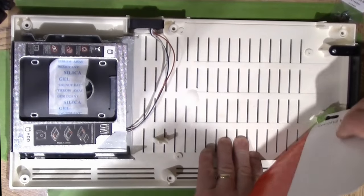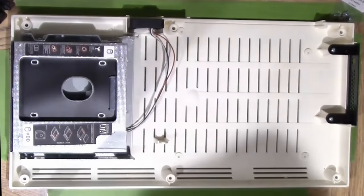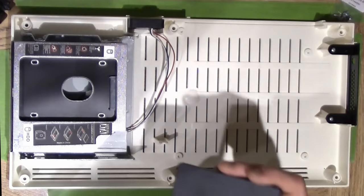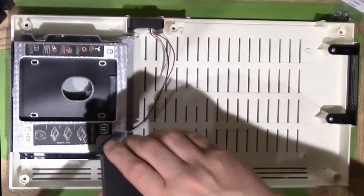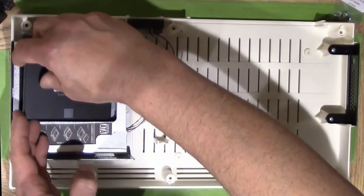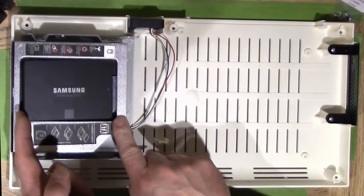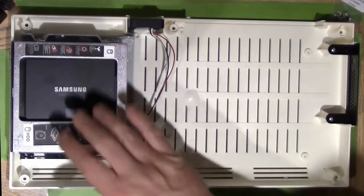This card has instructions on fitting the hard drive, but I'll show you now. The first thing before putting the motherboard in is to install the hard drive into the cradle. It only goes in one way — the connections here just line up. If it's upside down they won't align. Line it up, lift this end slightly, push it in this direction with a little wobble until it slots in, then let gravity do its job. That's the hard drive fitted.